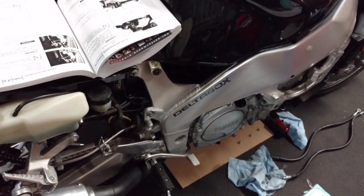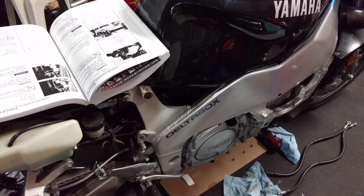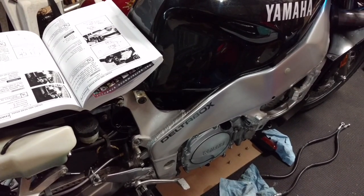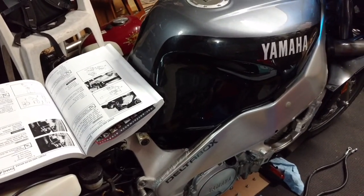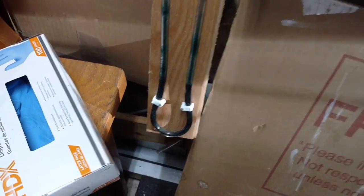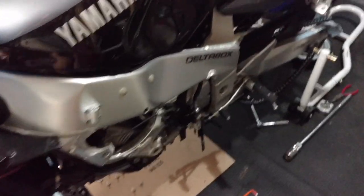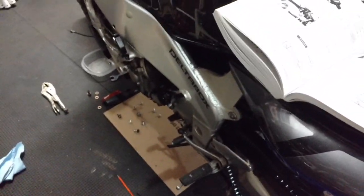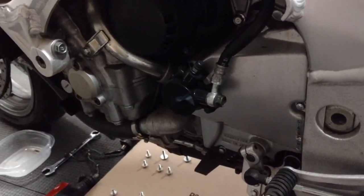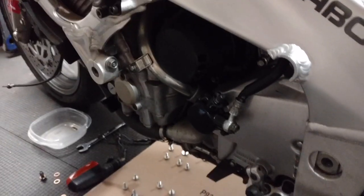The next big task after this will be carburetors. I did those last summer, but I didn't break the rack and I didn't fix the seals in the starter circuits. It seems like at idle I've got some hanging idle, which could be a couple different things. I finally got fittings to attach vacuum gauges to the intake runners, so I might get one of those carb tune setups. I had made my own manometer on a long piece of oak flooring with colored water, but the carb tune would be so much better. The clutch hose is to be replaced as well.